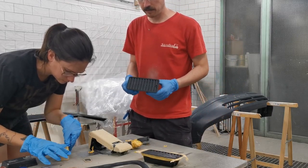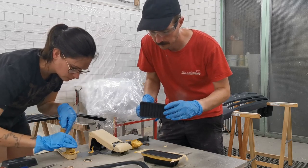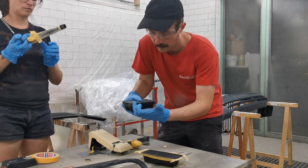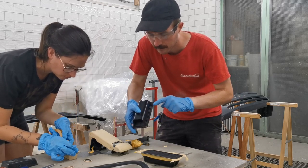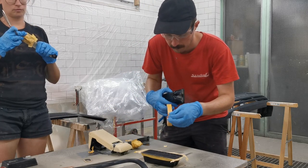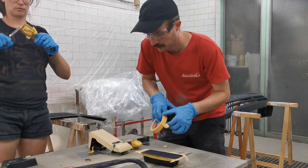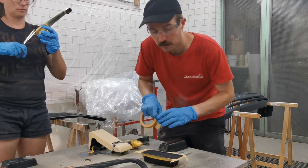The specialty of the Mipa Protector is that it has a very rough surface, which doesn't really line up flush with the body panel, so you get water trapped behind it. All the plastic parts that touch the metal still have to be nice and smooth — we have to put masking tape on all the flat surfaces that will touch the metal. That makes it a bit more difficult, but besides that, there's no difference from normal paint.